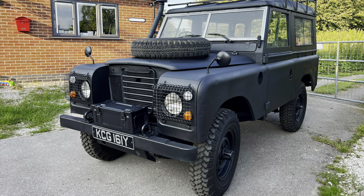Hopefully that video has been of some use — we've gone through the whole process. My recommendation is, depending on mileage — I probably do about 2,000 miles in my Series a year — I'll check the valve clearances once a year just as part of routine maintenance. They're old engines, old vehicles, but they are very robust, so give it a go. This particular Land Rover you'll start to see in lots of videos coming up — this Tomb Raider one that we built. We're going to be competing in some events soon and this engine is going to be the heart of it. Thanks for watching as always, and we'll see you again soon.